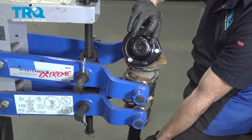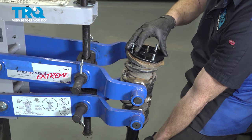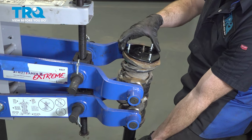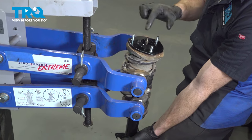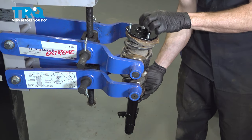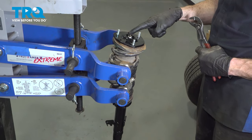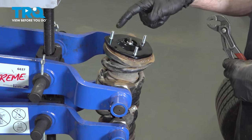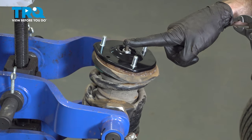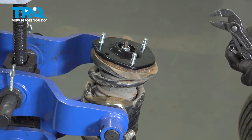Let's get ready to install our strut cap on here. We'll take this and slide it in position. Once you have it in position we're going to continue on to having it in the proper alignment point. After that you can put on your mounting nut. To tighten the mounting nut you'll find that the shaft of the strut will spin at the same time, so the first thing we'll have to do is snug this down. Once we've done so we can release pressure from the spring and then torque this to manufacturer's specifications.